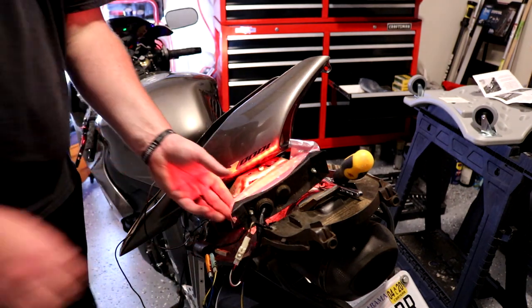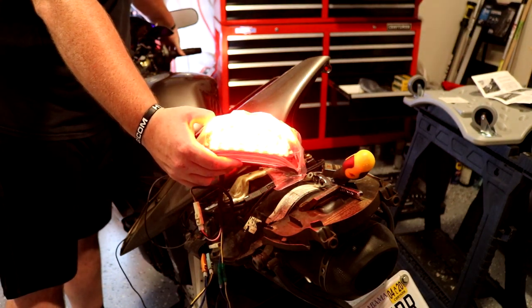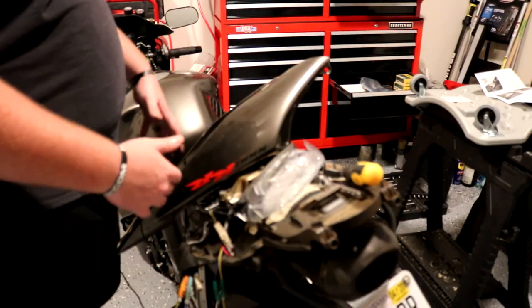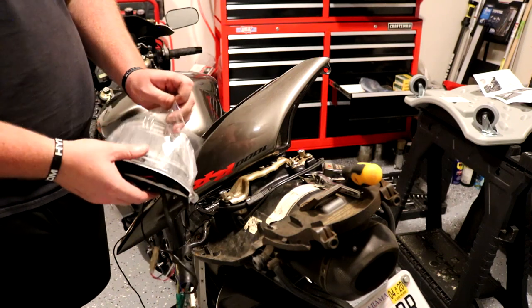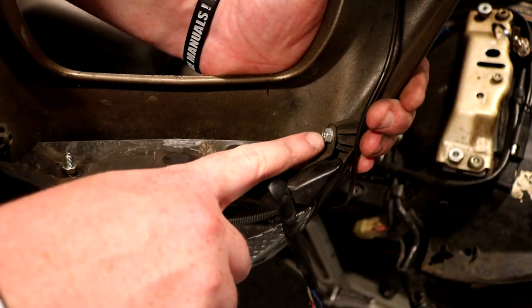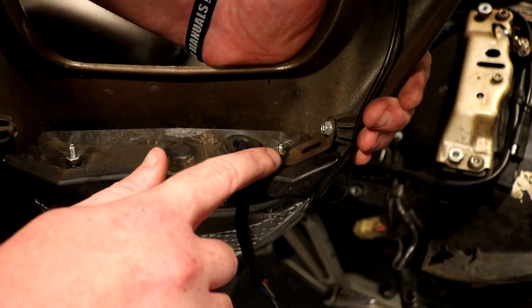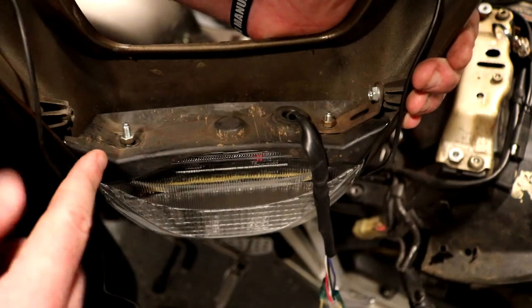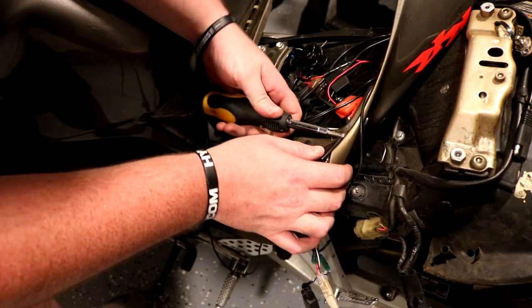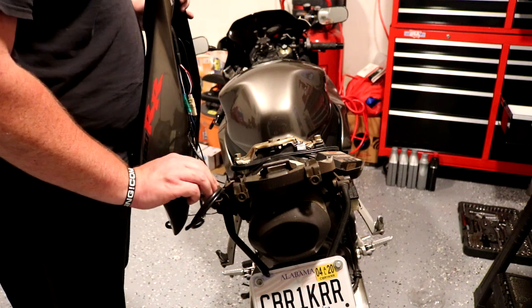So now would be the time to test it. That's pretty cool. So now that we have it all wired up, we're going to install it back into the tail. I had to go find a new bolt to fit in this hole because the other one was stripped out on the top really bad, but this one fit really well. All you have to do is get this bracket bolted to the taillight, then swing it up and insert the bolt on each side. Tighten the bolts down — don't go too hard. Tighten the nuts down just until hand tight, and route the wires the best you can. You may have to throw a couple zip ties on there.